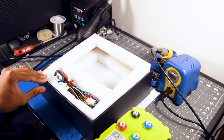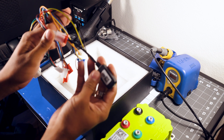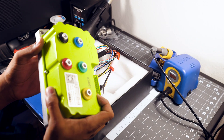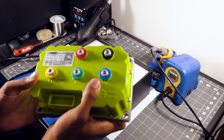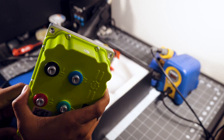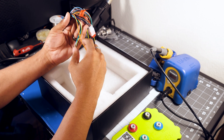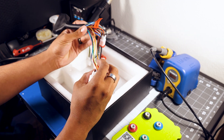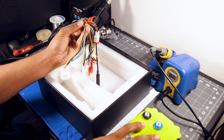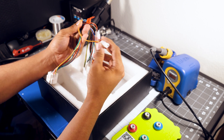You should just get the controller itself and then your wiring harness, which should include this Bluetooth module — it may or may not be attached when it comes out of the box, but this is how you'll set up all the settings. One downside of this controller is it is not nearly as user friendly as the Sabatons — the programming is a little more in-depth from what I've seen, but more parameters means I can have more fun with it. Going along to the wiring: you'll have your hall sensor connector which connects to the hall sensor on your motor. This controller is compatible with mid drive and hub drive motors.